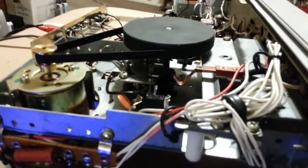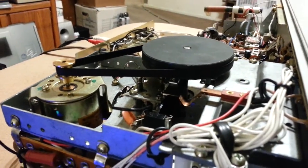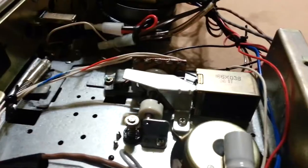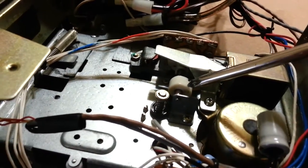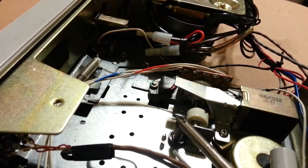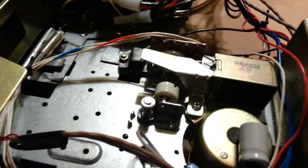On this particular player, the head — which in 8-track players moves up and down — is moved by a piston. That piston is driven by a camshaft underneath the unit, which I'll actually show you here. This is the bottom of the unit, and here you can see the camshaft. As it rotates, it pushes on a piston underneath it, and that piston pushes the head up. There's actually another piston right here which, if I press on it, you'll see that it actually moves, and that movement drives the head up and down, which is how an 8-track player actually changes tracks.